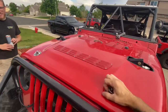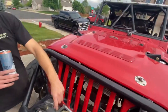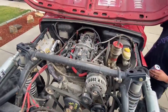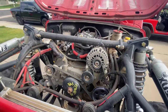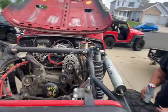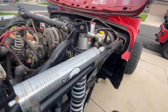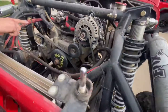While we're in the front, it has a 5.3 V8 - stock as could be. Still a V8, still probably makes close to 250 horsepower. By the time it gets to the tire it's about 150. It's like an '07 L33, aluminum block, aluminum head, flipped intake. Actually - wait, this is iron. Let me check with a magnet.